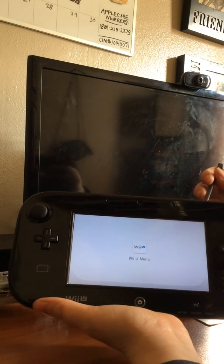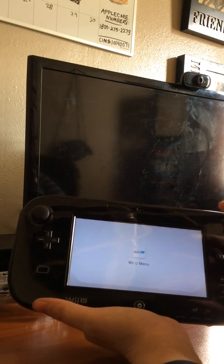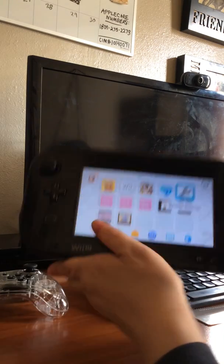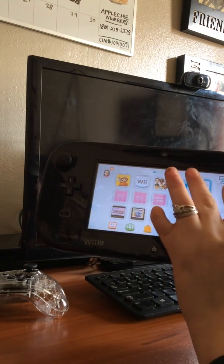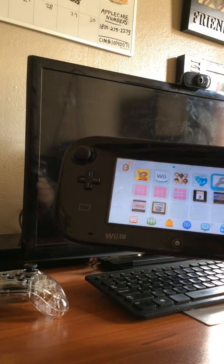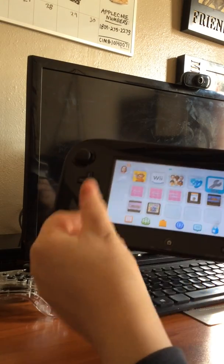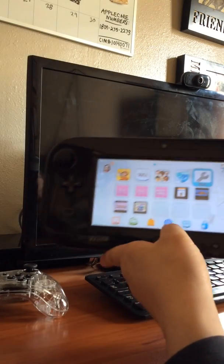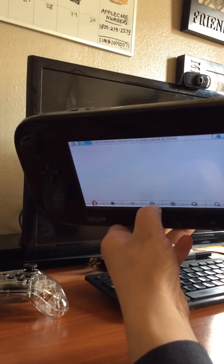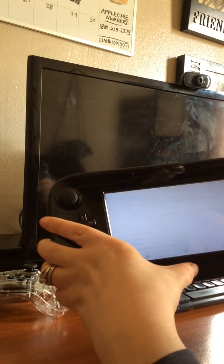I'm not sure if this is temporary or resolved, but if your Wii U is stuck on quick start or the touch screen is unresponsive, first clean the screen and make sure it's visibly clean. Then check the corners for debris. If that doesn't work, Nintendo recommends a dry toothbrush on the screen - there are many YouTube videos on that. If all else fails, you can use a fingernail or a card to gently lift the screen edge just a little bit.